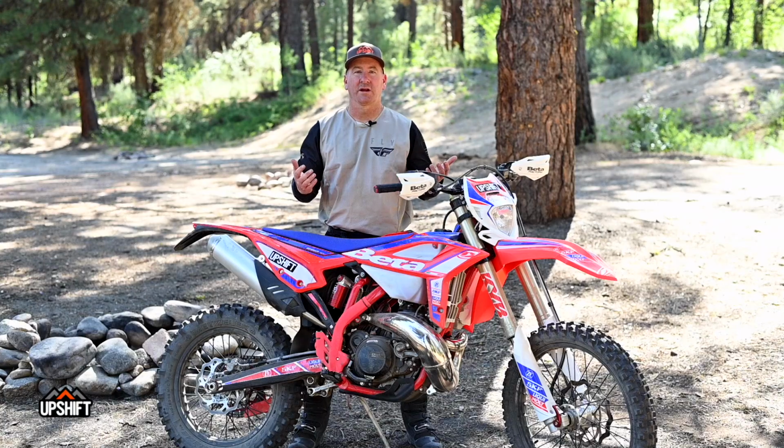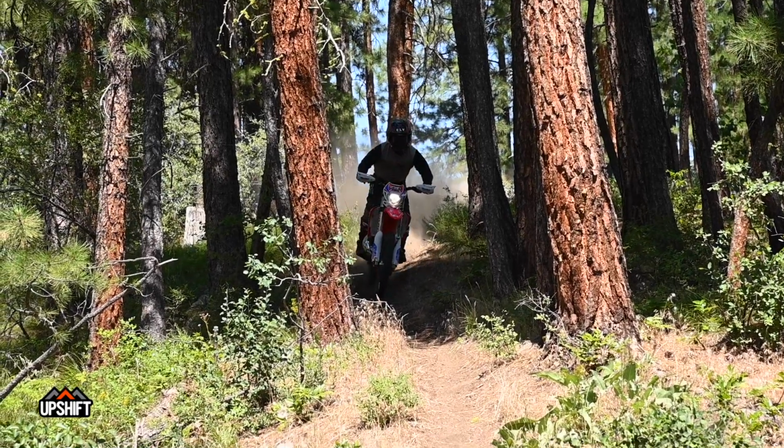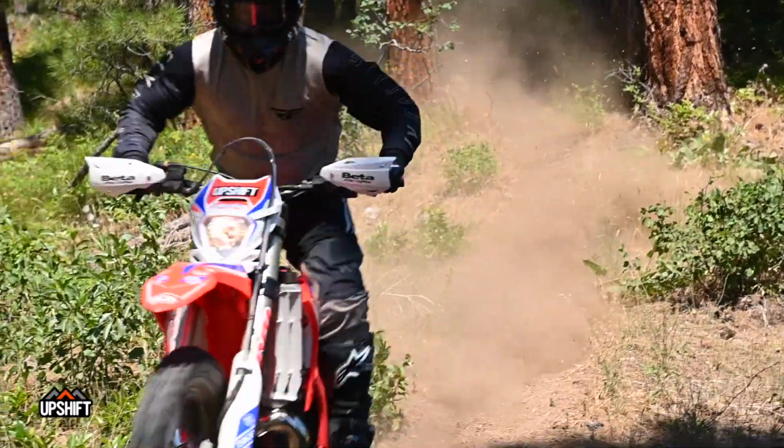With me on any bike, and I love them on four strokes and two strokes, I would put a stabilizer on. The last thing I need is to be going through a rock garden thinking I'm good and hit that one rogue rock that spits the bars, and then that spits the back end, and all of a sudden I'm shooting off into the trees. I like stabilizers that are set up for pretty much a high-speed circuit, where it feels like a normal bike until that huge slapper hits the front wheel or the back wheel, and then the bars slow down so I can control it.